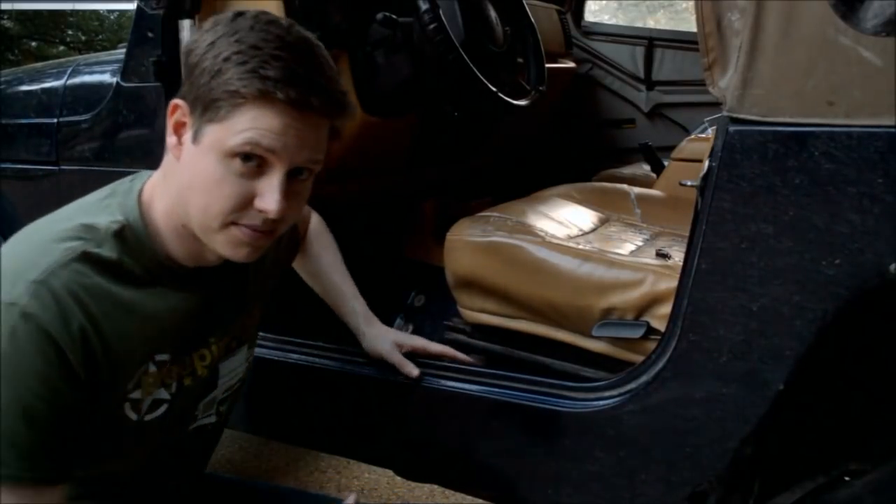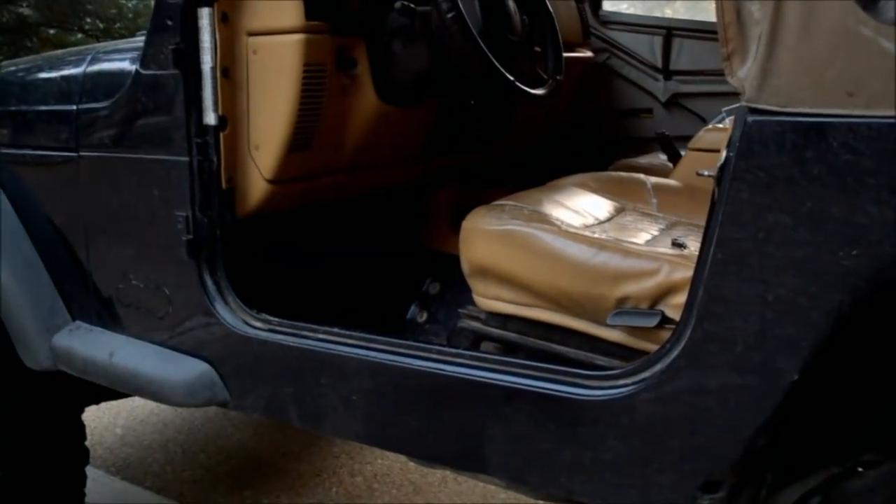I'm going to try to bring you into this really tight cramped wheel well space. I've got a small flashlight to point out what you need to do. There's a connector that is black, sticking down with the red line on it, that is not connected to anything — that's where standard from the factory my clutch connector was connected. Just to the left of that you see the square with the yellow cables coming out of it — that is the bypass connection location. You simply unplug and plug it in here. I've already switched it; it starts there, you unplug it and move it there, and now I don't have to use the clutch to start. Or you can put it back and forth whenever you want to.